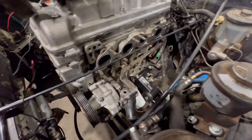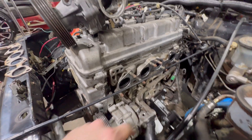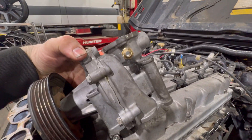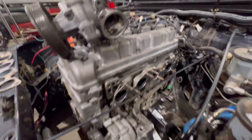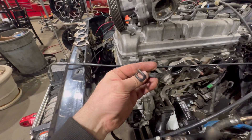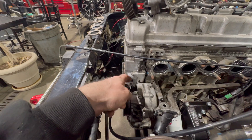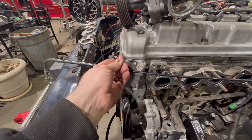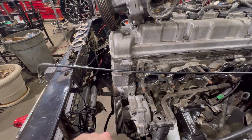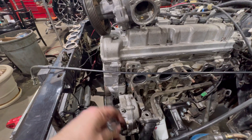Just while I was cleaning up I decided to take that fitting out and tap it into a different water pump on the bottom, and I'm going to Teflon tape it. We're going to run it down and come back up through this hole. I'm going to get one of those little bracket deals that Suzuki loves to put on everything and come off one of these bolts to keep that hose away from the pulley and belt. So it'll look like it was made to be there.